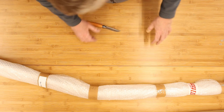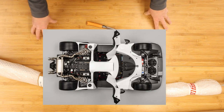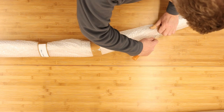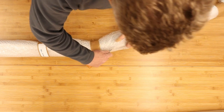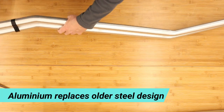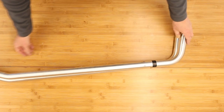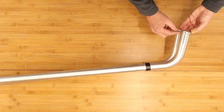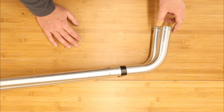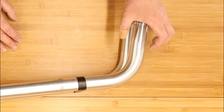Now, as I said earlier, the water, the coolant, needs to be fed from the front of the car to the rear of the car and the rear of the car to the front of the car. And this is done by these two. Oh, Pete the Penknife is doing it. And there we go. And what I particularly like is, if you see here, the ends have been flanged. Now that's superb, because when you put a silicone hose over this and you have your Jubilee clip on top, if you don't have a flange, there is a risk under extremely high pressure, the hose can blow off.